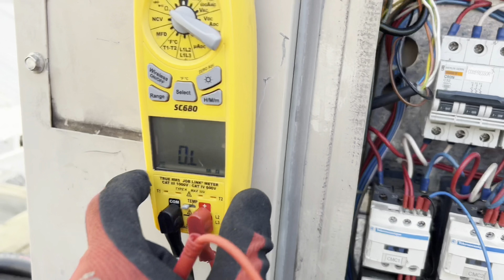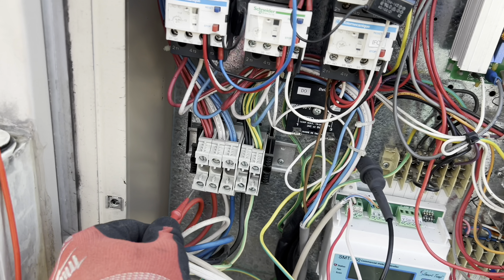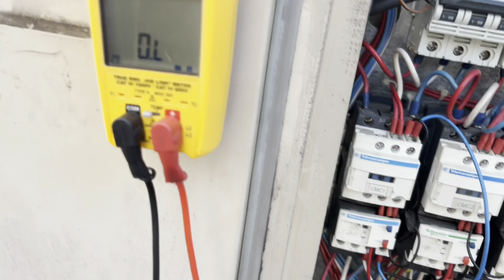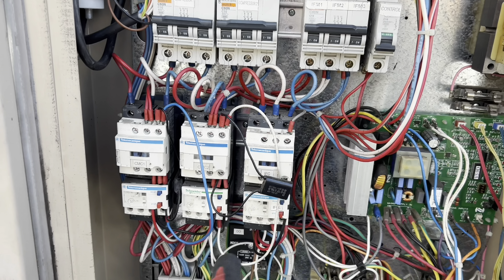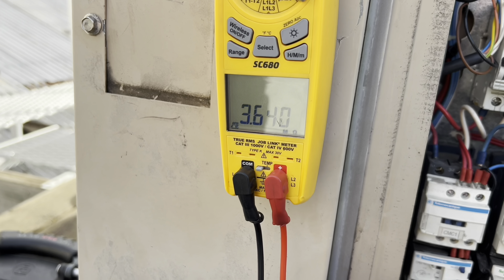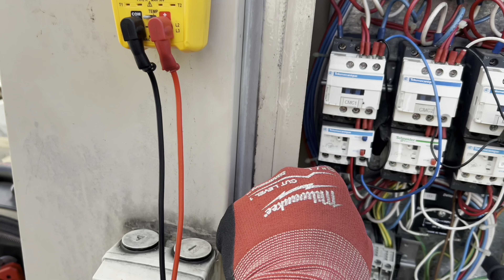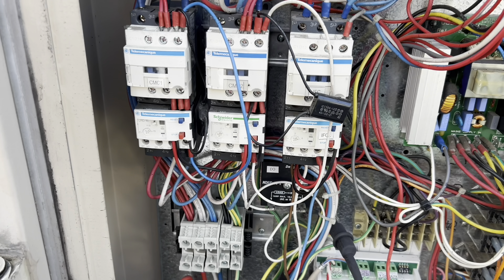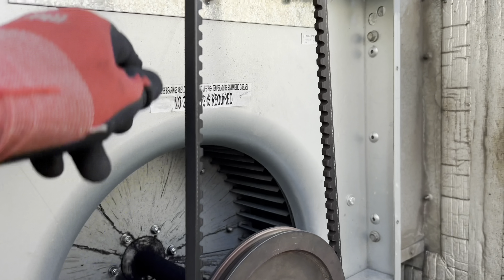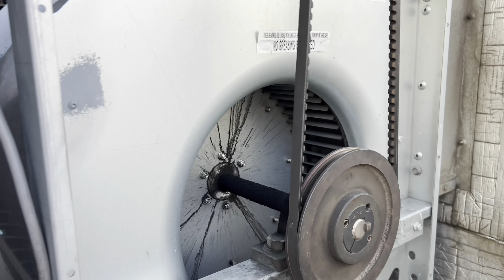I'm going to go through with my meter now. I've got it set to ohms and we're down to earth there, so we'll just see if we're getting a reading. We'll start with incoming power. I'm going to test this electrically. So far I haven't found anything. I'm about to pull the board off to see where the tracks to that part follow. Just having a look at the fan motor — I think the belt's pretty loose, but apart from that it's not seized. The damage there is pretty impressive.